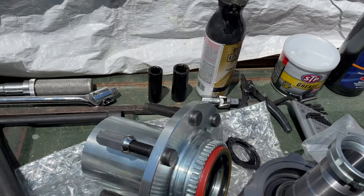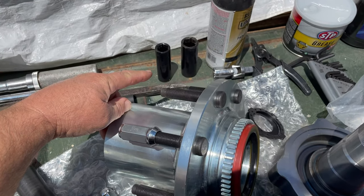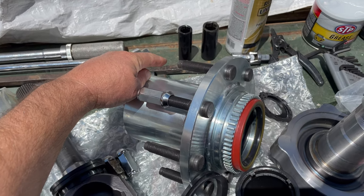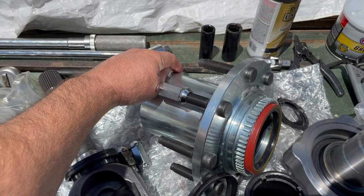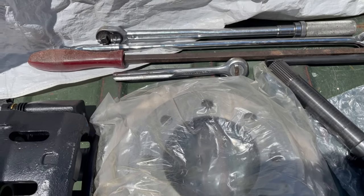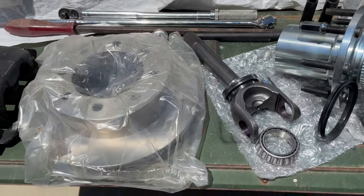Of course a little paint. You'll need a 17mm and a 21mm socket. The 21mm is for the retaining bolts that hold the hub on and also for the brake caliper bracket. The 17mm will be for the slide pins on the brakes. Also you'll need a torque wrench, pry bar, ratchet, all that sort of thing. Get yourself some good sturdy jacks because these are heavy. Alright, let's get with it.